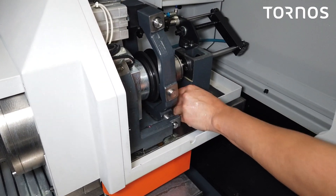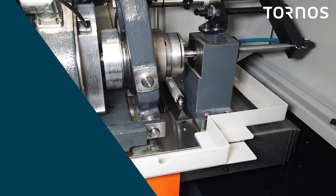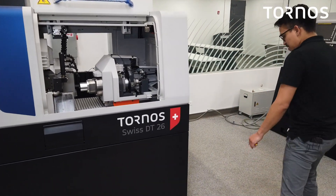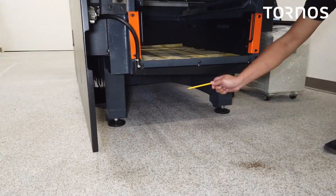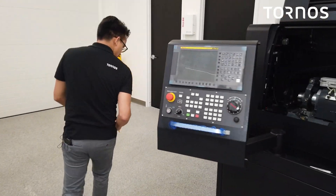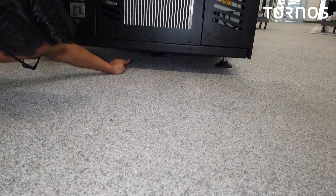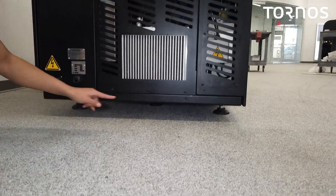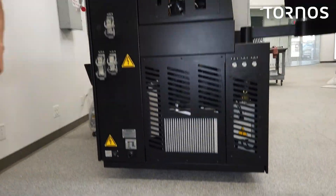Now that we've got the level in the machine, you're going to need an adjustable wrench. The leveling pads are here — you've got one here, one here. And the last one's down here in the middle, and these two on the sides are for stability, not for leveling. The main one you are concerned about is that one and the two on the opposite side of the machine.